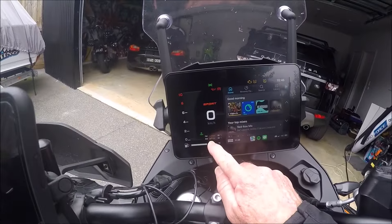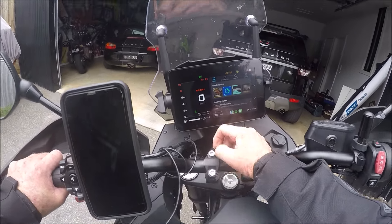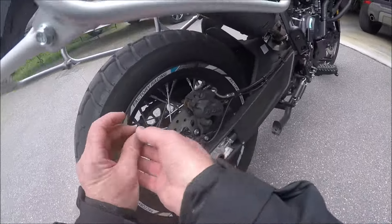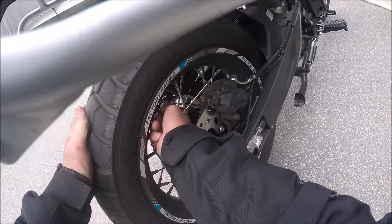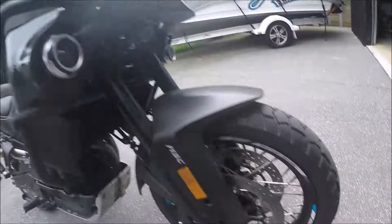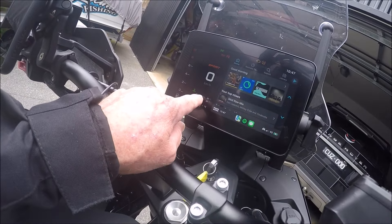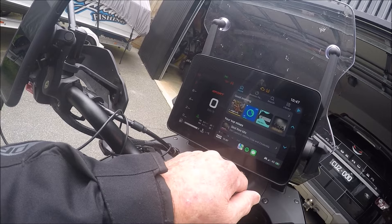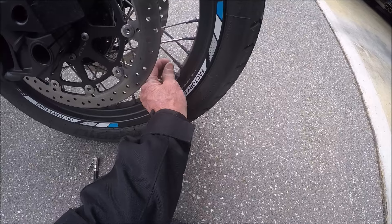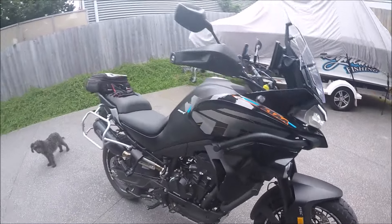After pumping up the tires, you can see the rear has gone from red to 2.7 bar and into the white — that's where we need it. They're so sensitive. The front is about 2.3 to 2.5, which is good — it's gone out of the red into the white and the warning light is off. Happy days, let's finally get on the road!